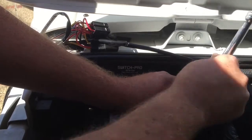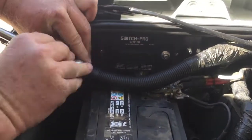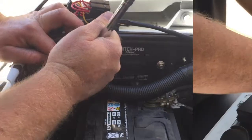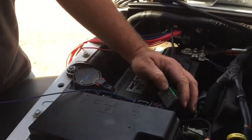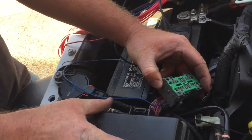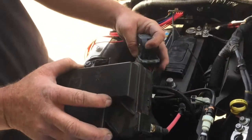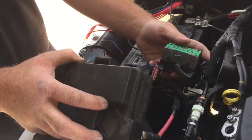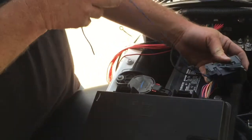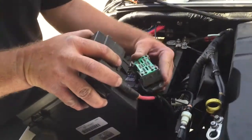As you can tell, this is a pretty impressive, clean little install here — nothing massive underneath the hood on the firewall. Keeps it nice and clean. We went ahead and tied the accessory wire into what Greg called the C6 connector. We pulled the box out, undid the four tabs, and pulled the plug off the bottom — which is difficult to do, but it's a much cleaner install to put the wire in this way. We removed the wire cover, put the blue wire in, re-secured it just like the directions said.